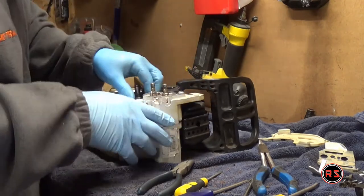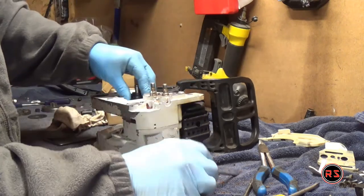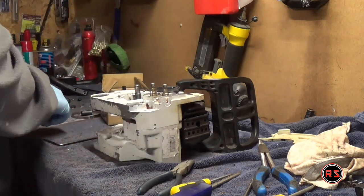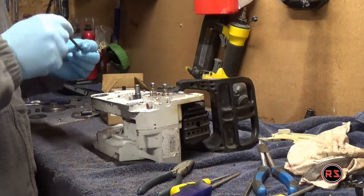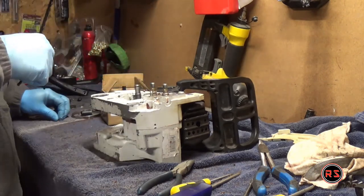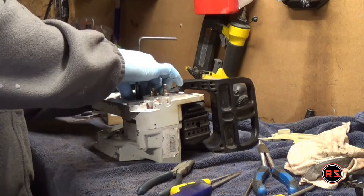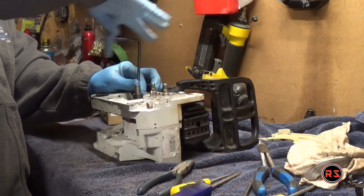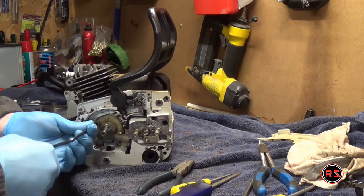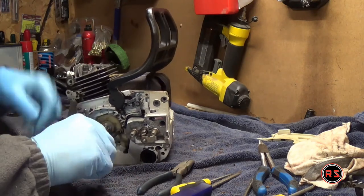After the line is at its place, put back the oil pump at its position, apply a little pressure around the oil line to make sure the pump is at the right position, and put back the two bolts. Again, it's plastic and aluminum so don't put them too tight — if you're not sure, use the torque spec. The bolts sit pretty tight on the crankcase so there's no big chance of a mistake here unless you over-tighten. The two bolts are in their holes — just tighten them at the right torque, going by feel using the tool that came with the saw.